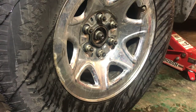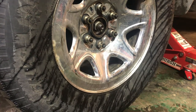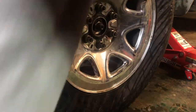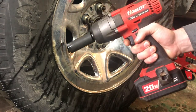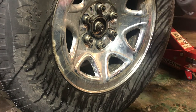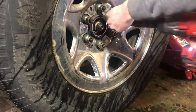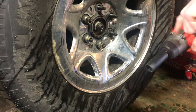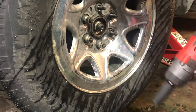So they're all loose. Off the ground, and then I have a jack stand back here — make sure we're being safe. I do have an electric impact, it's a half-inch Bauer. I torque these lug nuts to 110–120 foot-pounds when I'm done putting the tire on, and it'll take them off but it hammers for a while. So I still crack them loose first — it's just annoying to listen to. A stronger impact will take lug nuts off on its own, but this one doesn't; it's pretty weak.